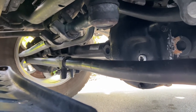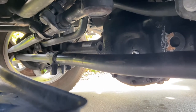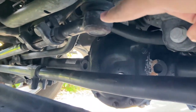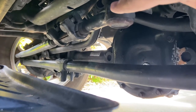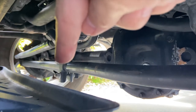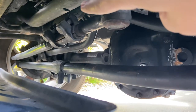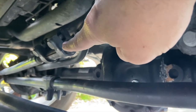That's pretty convenient because it means I can straighten out my steering wheel without paying for an alignment. The way this is done is you have what's called a drag link right here — this directly connects to the pitman arm on your steering box and that only adjusts the right wheel, like the relationship of the right wheel to the steering wheel. Then there's another bar on the bottom that controls the toe in and toe out between the two wheels.